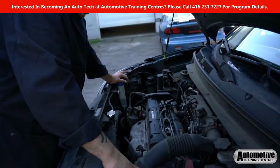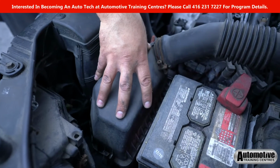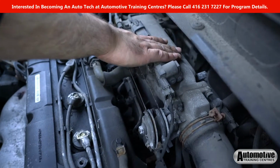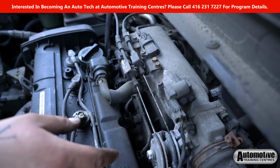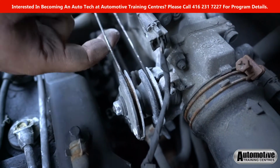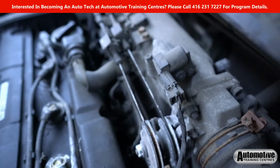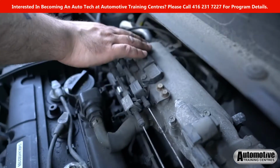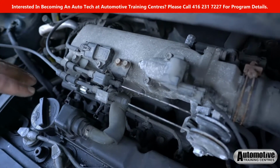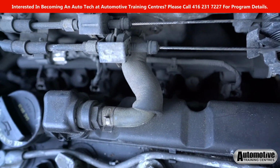So when we talk about the intake system, the air comes in from outside, gets filtered from the air filter, it travels through our intake tube, and then it enters into our intake manifold. On this particular vehicle, we've got an older style mechanical throttle that's controlled by throttle cables that hook up to the throttle pedal inside the vehicle. The air then continues on through the intake manifold, and if you can see down there, it then enters into 4 individual ports which enter into the engine.